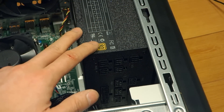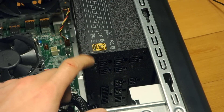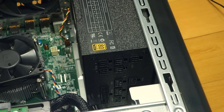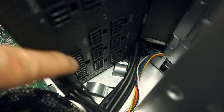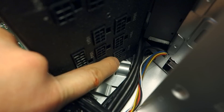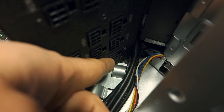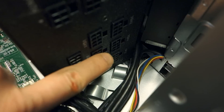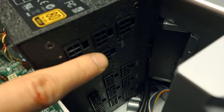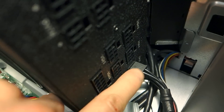Given that space is at a premium with this oversized PSU in the XPS 8700 chassis, I'm going to start at the back of the PSU and route cables forward to the motherboard and devices. I'm going to start with the one labeled CPU2 first because that's the furthest one away and the tightest to get to. Then I'll hit the VGAs, and last the SATA ports. Now that CPU1 is in, CPU2 is right beneath it but I don't need to use it.